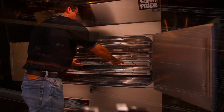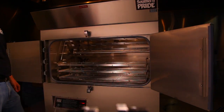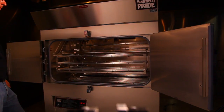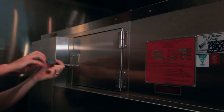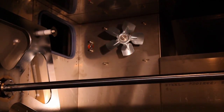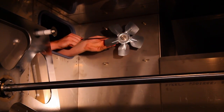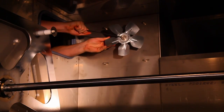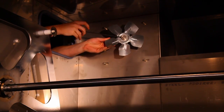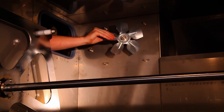To remove, simply take the food racks out, then remove the hanger assembly, and use the foot switch to advance to the next rack. Most of our units have an access door that allows you to easily remove the convection fan for cleaning. The fan must be cleaned regularly to maintain even airflow and consistent temperatures throughout the interior cabinet. Simply loosen the allen nut and remove the fan — it can be cleaned by hand or in your commercial dish machine. To reinstall, place the fan back on the shaft and tighten the allen nut.